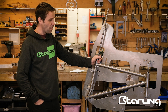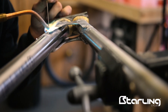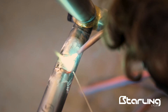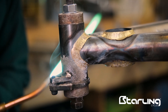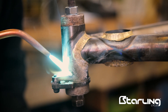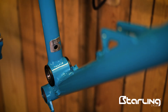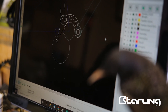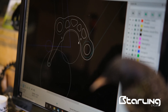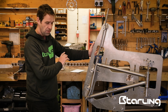The new bike, the Twist, is a mullet bike — a 29-inch front wheel with a 27.5-inch rear wheel. The big 29-inch front wheel has a lot of gyroscopic stability, which allows the front wheel to track better through rocks and carry speed. The smaller rear wheel is more maneuverable and allows you to hop the bike around better — it's a sensible compromise between 29 and 27.5 and it works well. Because of the way I've designed the bikes, it's very easy to put a Swoop swing arm straight onto a Murmur front triangle and get the right bike with correct geometry and no compromises. We can move the shock mount forward slightly to fit a 230x65 shock, giving 160mm rear travel — so a mullet bike with 160 front and 160 rear, no geometry compromises.